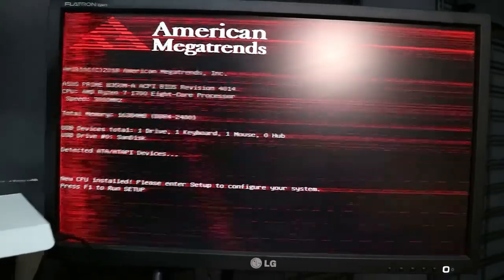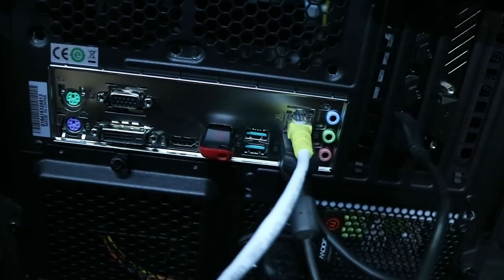Last I said I was going to install an OS and report back — it's been about two weeks of going well so far. A few little hiccups with the build: we had terrible red lines across the screen which totally freaked me out, but it just wasn't plugged in properly — it's working now. And the I/O shield had little tabs that got caught in the USB ports when I was putting it in. I had to undo the motherboard, move it back just that far to bend those tabs up and put it back in.